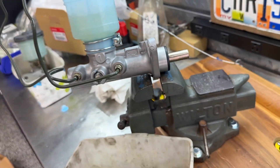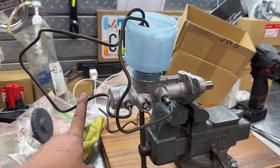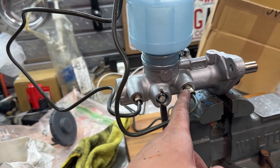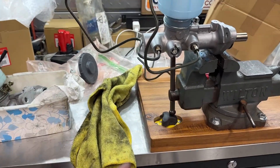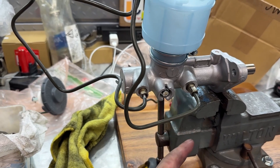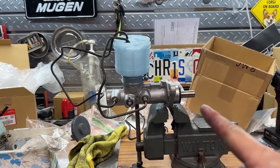Here I have a brand new brake master cylinder, and what you need to do is bench bleed it. I have the lines that I took off doing the ABS brake upgrade. Keep in mind that the rearward port is larger, so it has a special fitting. I have these lines fed into the top so I can loop them around - that's how you bench bleed it. I'm going to install it in the car like this and then do a quick swap - Indiana Jones style - over to the upgraded lines, trying not to lose as much fluid as possible. Then I'll do a full bleed of the system.